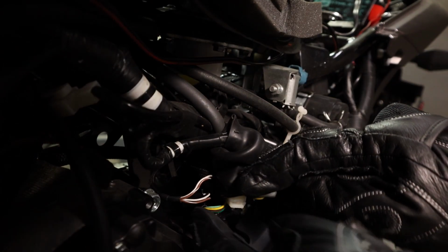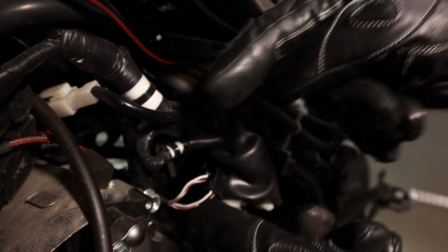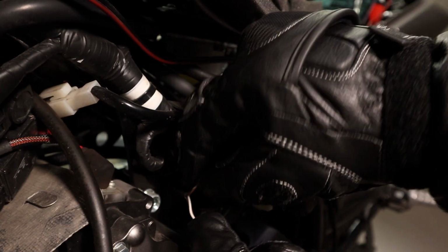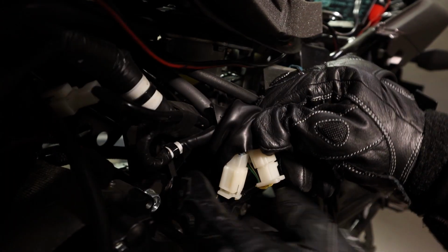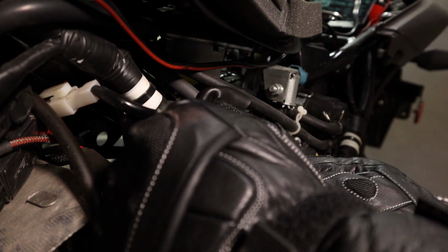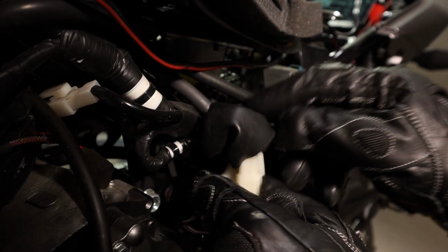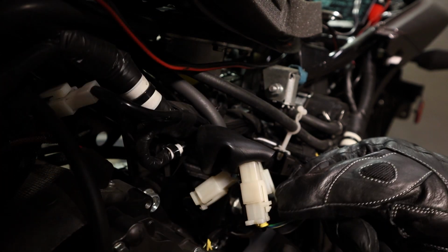No! Run the brown wire connectors through to the other side of the engine. Use zip ties to make the wires neat. Roll up the boot and you will find 3 plugs. The smallest plug is the crankshaft position sensor. Unplug it and plug the Power Commander brown wired connector here.